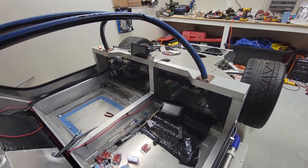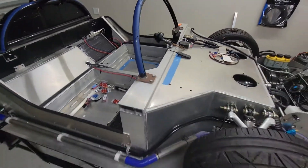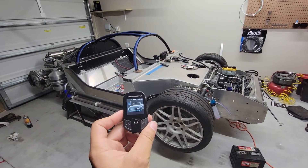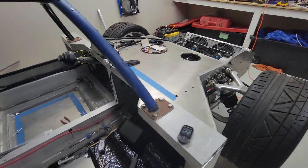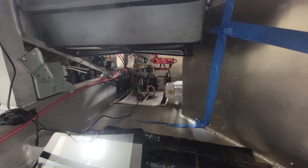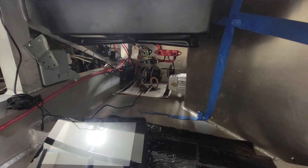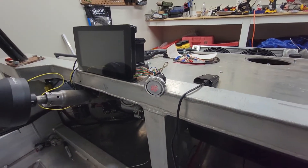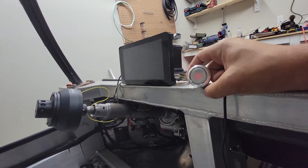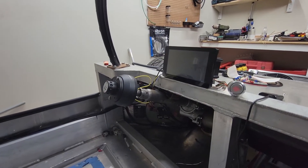Let me show the key system and how that works. As soon as I pull it over here it'll unlock because now it's in range, and you can see the infinity box system powering up there, with the green and blue LED flashing for the battery isolator. That's pretty much how the power works. We've got a glowing red button for the engine start — go ahead and turn that on to ignition on, and we get power to the screen for the gauges and also power to the power steering, which is functioning as well.